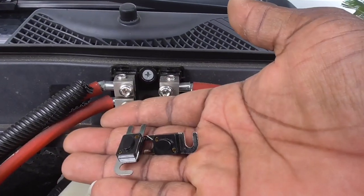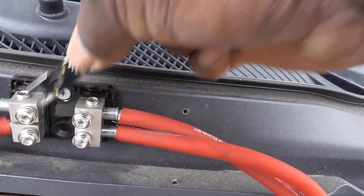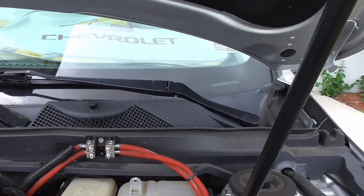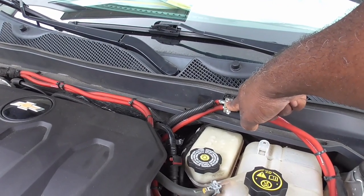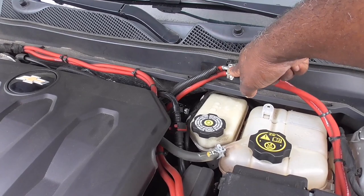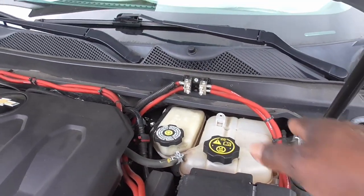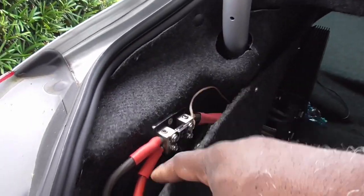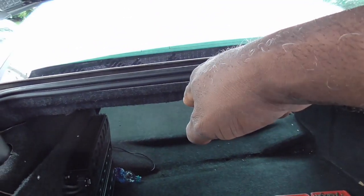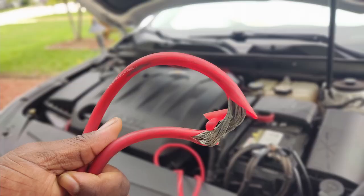I just took these two out of here. They hook in like this and then they just slant and latch closed. I'm not going to connect that and I'll tell you why — it's freaking me out right now. This wire runs to the rear of the car, to my amplifier. It goes about three feet down into the engine, then through the firewall through a grommet. But that wire up front, before it goes into the firewall — the insulation is completely shredded off of it. So damn dangerous.